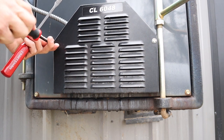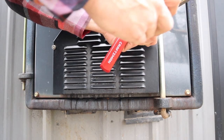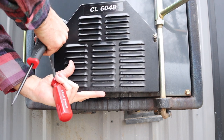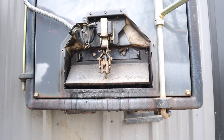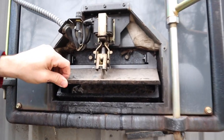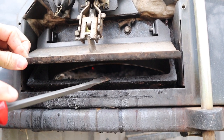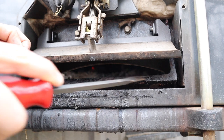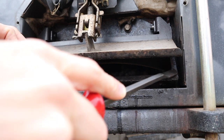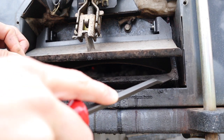You might have a central boiler, you might not. The central boiler makes it pretty easy to take off the exterior shield with just two flathead screws that go into the sheet metal anchor nuts. Once you take that off, you have your draft door on the outside. The mating surface right along here is what you always want to keep clean — it's inevitably going to keep building up with all kinds of junk that just comes out from your combustion.